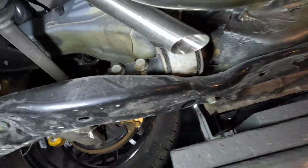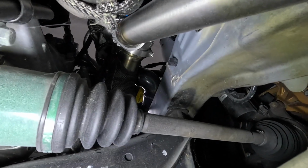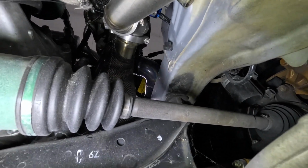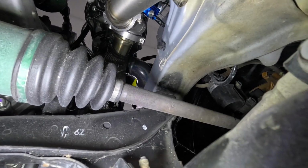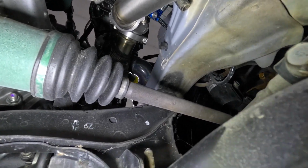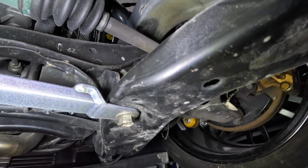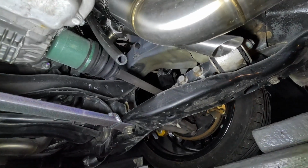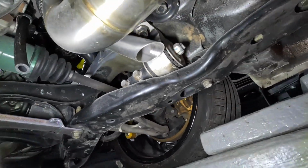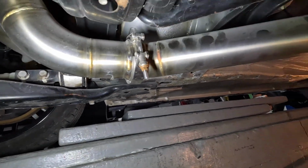Now, obviously it goes up to the turbo. As you can see there, I have another heat shield on the up pipe, because I just want to keep the heat managed. Then we have the wastegate, that's the Tial 44mm. The turbo setup is a 6466 Precision with a 1.05 AR. So here is the custom downpipe for the rotated kit, and then the dump tube for the wastegate. So here we go.